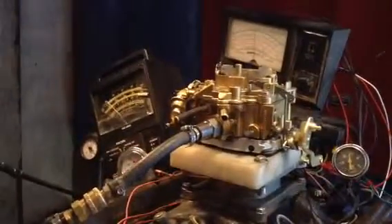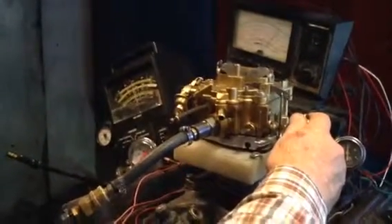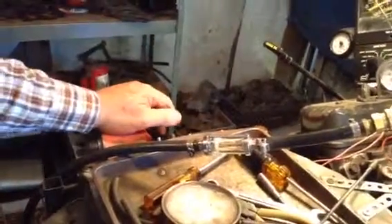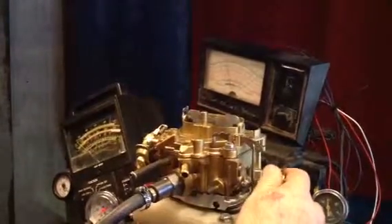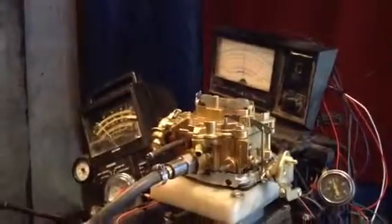High RPM test with a light load. Now we're going to go back and switch on the dynamometer and put the brake on. Now it's going to start applying — you're moving the hydraulics back there. The faster you torque them up, the more pressure it puts on the engine. Now we're going to go ahead and put our RPM control on it so we don't blow the whole thing to pieces, and we're going to take it on up and see how much capability this carburetor has to supply fuel at so many foot pounds. I'm watching that top scale up there — 475 foot pounds right there. Okay, you heard it, you saw it.